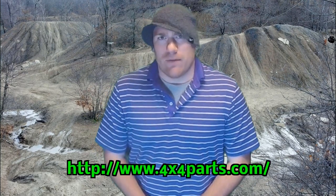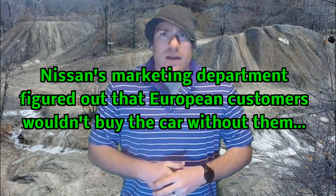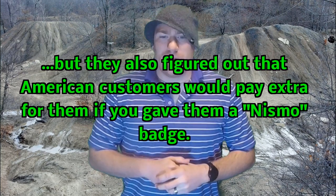The typical entry-level performance cam for the VG33 is what they call the Eurocams, available on 4x4parts.com. Those have a 264 degree intake duration, 262 degree exhaust duration, and 0.393 inches of lift. They're called Eurocams because, as I showed in my junkyard videos, the Z31 cams are directly swappable with the VG33. The Euro-spec Z31s sold in Europe originally came with this profile stock — it was a more performance-oriented camshaft. The American Z31s had a tamer camshaft with less duration, though you could get the Nismo performance camshaft for American Z31s, which was basically the same as the Euro stock camshaft. So the Eurocams are a direct Nissan part, which is reassuring if you want factory-quality fitment — it's just being repurposed for the VG33.